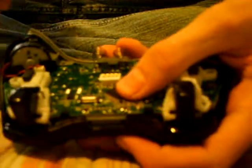because when you push it down, the controller pushes itself up because it's pushing down on the axis like that. What I do is, I put it in with the triggers in first, and then sometimes these little springs will get in the way. That's where you put your battery pack. You simply just move those out of the way, and then all you do for the final step is just simply put the screws back in. Doesn't matter which ones you use, and there you go. That's how you put your Xbox 360 controller back together.